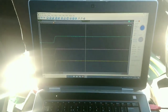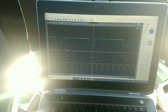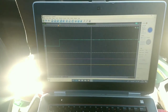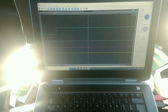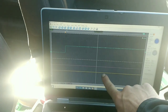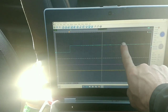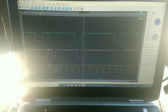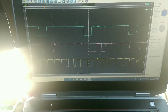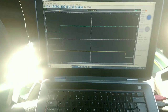To check the crankshaft sensor is working I've put the scope onto the crank and the two camshafts. Starting the car - see how it stopped running after a while. So that's what's happening - same as before except now I don't have a rattly chain. It says it's the crankshaft fault, but here the yellow trace is the crank and the red is the exhaust cam and blue is the inlet. The crankshaft is still getting movement after the car stops, so I don't think it's losing the signal and then stopping.